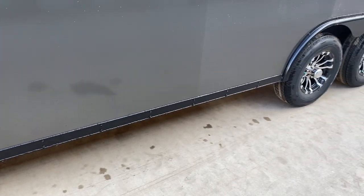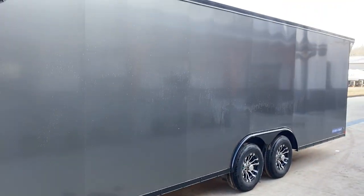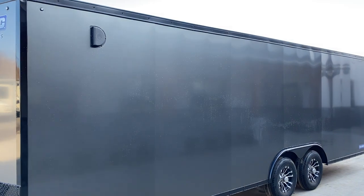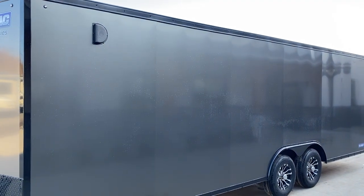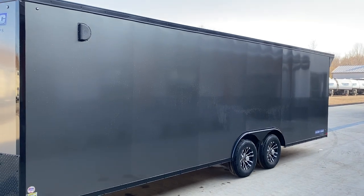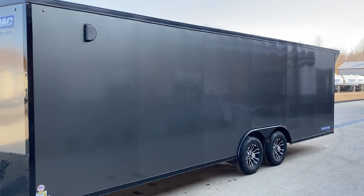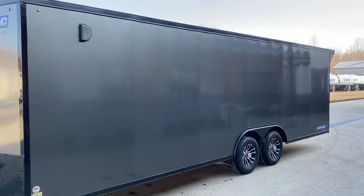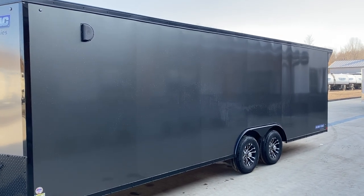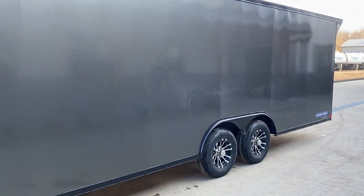Going back to the side, you'll notice there are a lot more lags — a little bit nicer, a little bit heavier trim. It looks cleaner too because there are no rivets; it's a screwless exterior. It's 030 metal. Most trailers you're going to see either 024, which is more economical, or 030. On high-dollar stackers or taller trailers, occasionally you'll see 040, but that's fairly rare on anything this size.